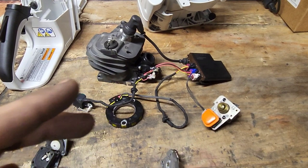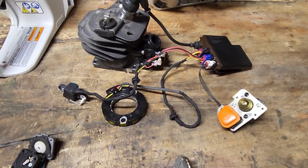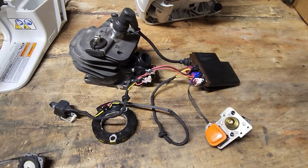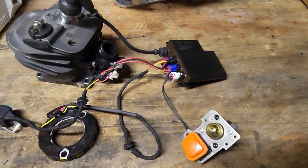I've tested this stuff. I used to hear all the time that on a 500i, the thing to do was advance the timing and open up the muffler, this, that, and the other. And now people don't say that anymore. I think people have realized that it actually doesn't do anything. You can advance the timing all you want. It's not going to do anything.